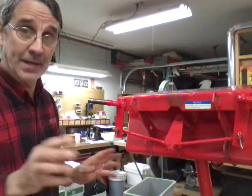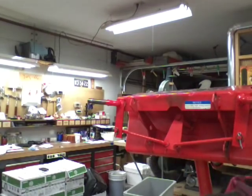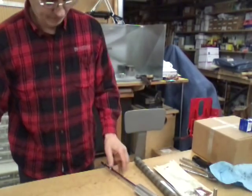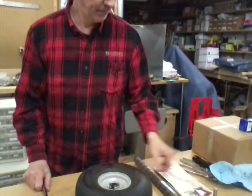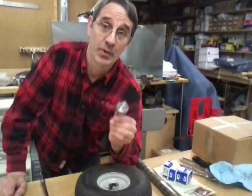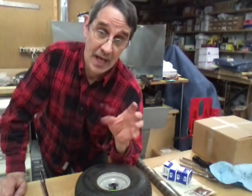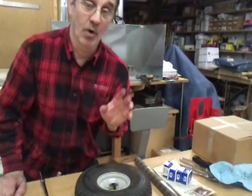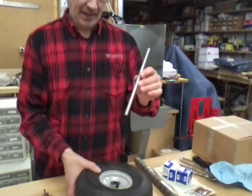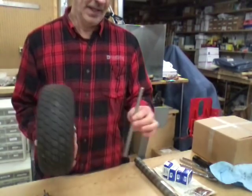Now the tires. I got new bearings for the tires. I'll show you how I get the old ones off. The new bearings we will press in with a bearing tool made for installing bearings. You never want to pound a bearing on a shaft or into a bore — you always want to press them in. To pull them out, you can use a rod and go through the bearing on an angle and hit the bottom bearing and knock it out with a hammer.